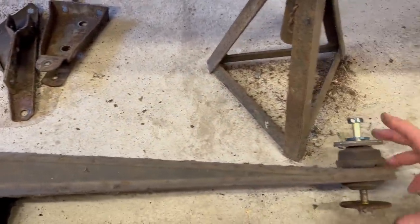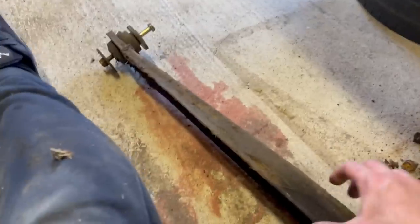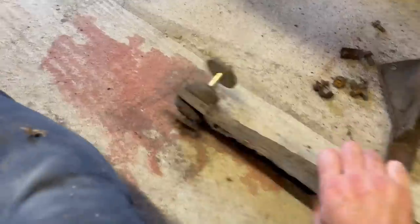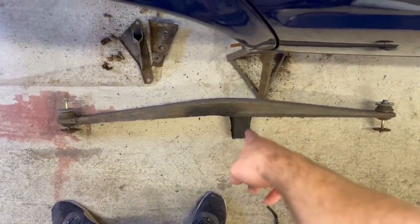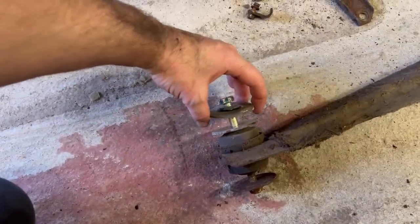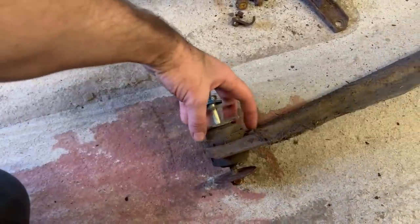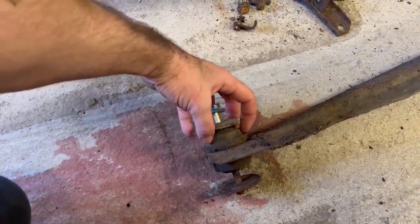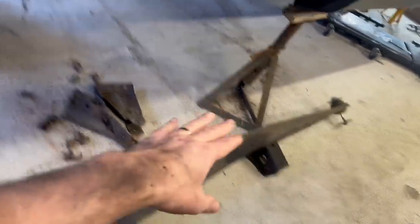Another SD1 first for me. This is one of those weird things. It's a suspension geometry issue. So this whole beam carries the forward end of the axle, so the torque extension tube hangs in there. It sits on bushes, and early cars, if I remember rightly, series one cars only have one washer between the top of this bush and the underside of the car. Very late cars, I thought, had three. So in effect, it's spacing this whole rear beam and the nose of the axle down.